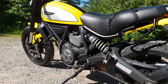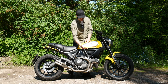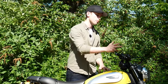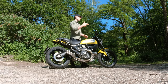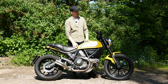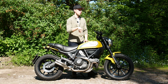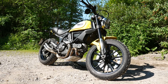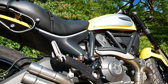It's got pretty limited ground clearance, and all of that delicate Italian underbelly is exposed unless you put that bash guard on the bottom. The big and most obvious point is that the throttle control is not precise at all. If you're taking it off-road it's got a decent amount of engine braking as well. So when you're on and off the throttle — if you're on it, it's going to throw you back in the seat if you hit a bump. If you roll off too quickly you're going to get engine braking and start to drift over the front of the bars, which is not enjoyable. You'd have to feather the clutch, and that just makes it a little bit harder to work with off-road.